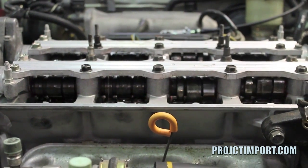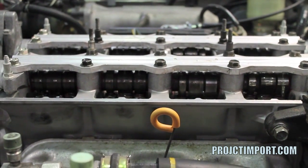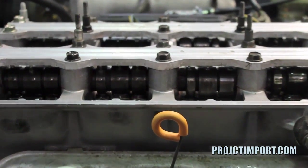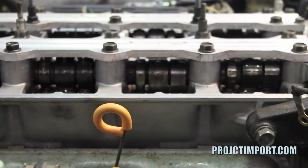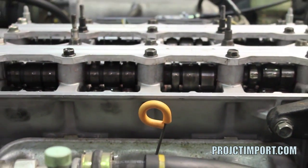Overall, if you're planning on putting a new motor together, putting it in a car, and starting it up fresh, realistically the best way to prime an engine is to take a primer and inject oil into the system and make sure the oil goes all the way through the motor. We also still pack the oil pumps on cars, just to also help that initial start up.